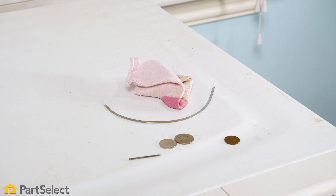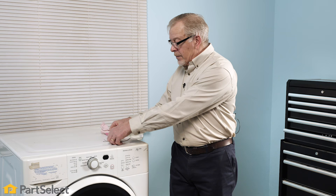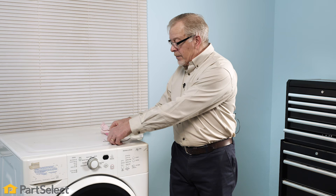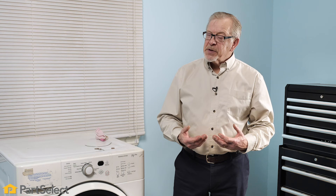The most common causes for noises in a front load washer is usually a foreign object that has gotten caught between the inner and outer basket. Items like small baby socks or articles of clothing, coins, nails and screws, bra wires, bank cards, plastic toys — those types of things can fit into that space between the two tubs and eventually cause a noise.